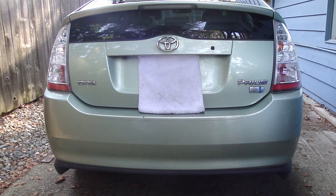Hello, David here, and the project for today is dealing with a dead 12-volt battery on the Toyota Prius. This is a 2007 model, Generation 2, and the battery is dead and I'm not able to open up the rear hatch. The battery is in the rear, and it doesn't have a key lock for the rear — it's all electric.